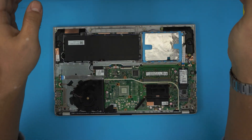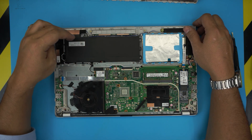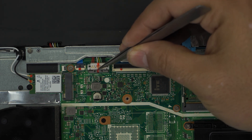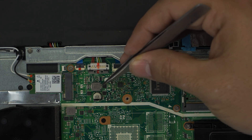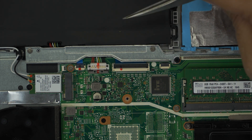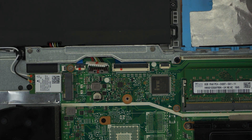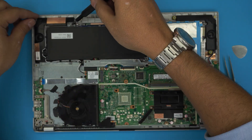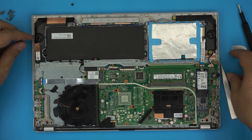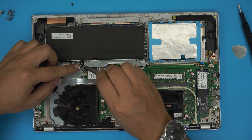Once you remove the bottom cover, you'll see the battery right here — it's the square piece, and it's a polymer battery. To disconnect the battery, grab the metal cover and push it toward the motherboard end to slide it back. Then pull the jack up toward the ceiling to disconnect it. To remove the battery, there is one screw at the back — remove that. Then you can go ahead and untangle the Wi-Fi cable right there.